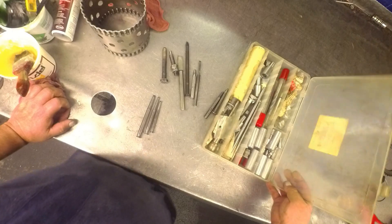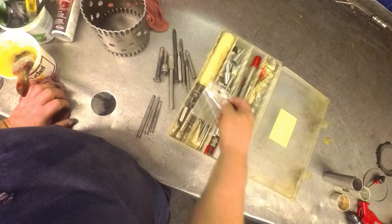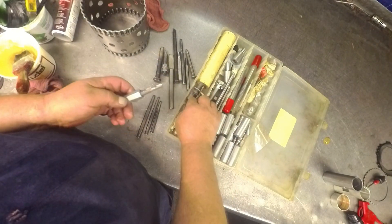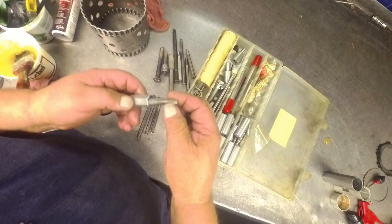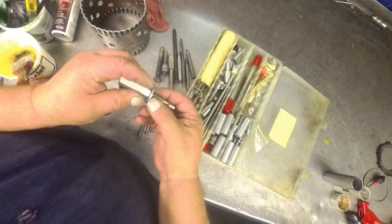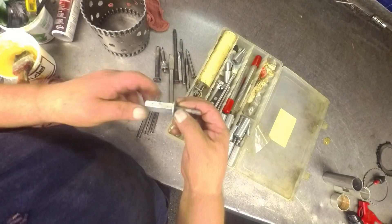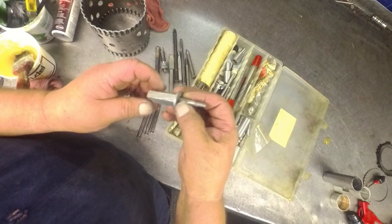This one here is for the older Toyota units. There's actually a washer that goes on here — you would screw this into the bushing and then hold the back side here and tighten this down. It would basically do the same thing as the other one, except instead of pushing it would pull. You just tighten it down and it would pull the bushing out.